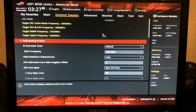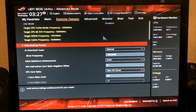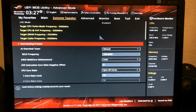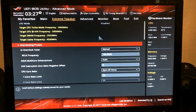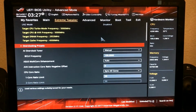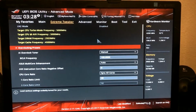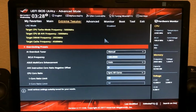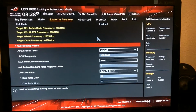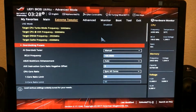Beforehand, when I first got it out of the box and I let the software auto overclock, if you go back and watch one of my older videos called Fear of Clowns, I was doing a stream on that, and while I'm playing the game I get several temperature warnings where my CPU hits 84C, and I believe it's running at 4.8 or 5.0. I'm not sure exactly, but that was with the auto 5 gigahertz overclock that's set up automatically in the BIOS here. And that was just terrible. To me, before doing the delid, the results were garbage because the temperatures were just too high.